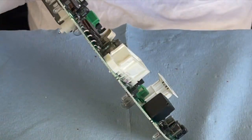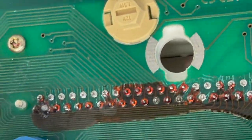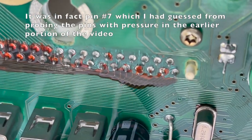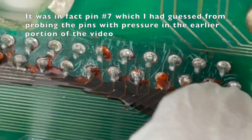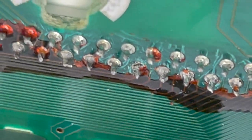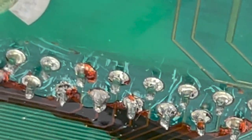All right, this is what it looks like. Not done yet, so I still have some more. I think I found the culprit. I know it's hard to see, but that's the one — right there. It's got some... looks like a cracked joint. And when I exposed it, it showed that joint. So, I'm still going to work on all of them, but that's, I think, the culprit.